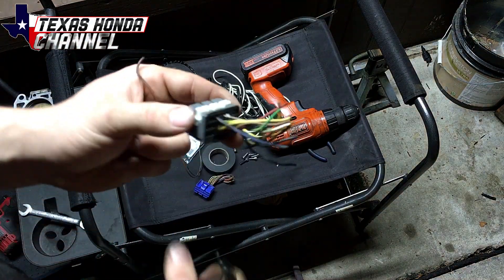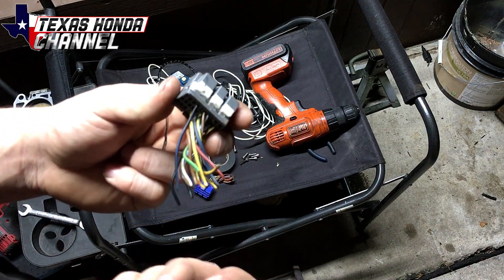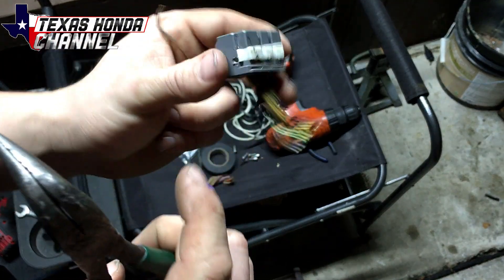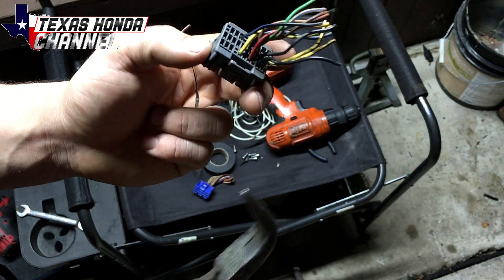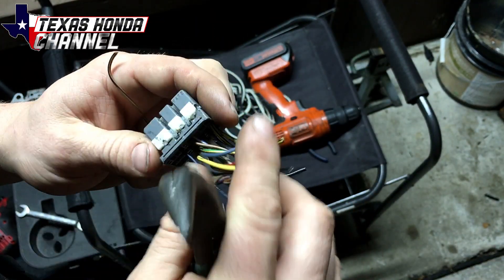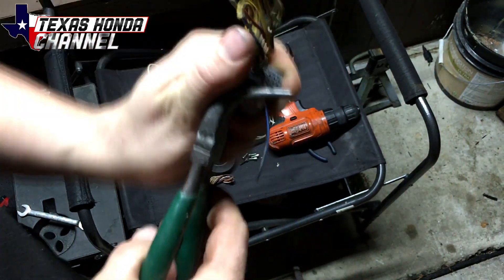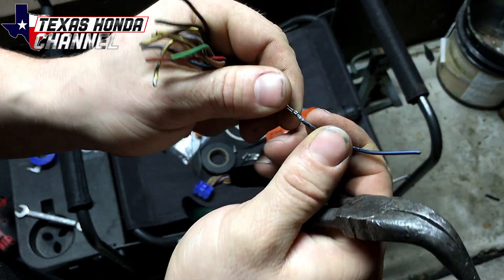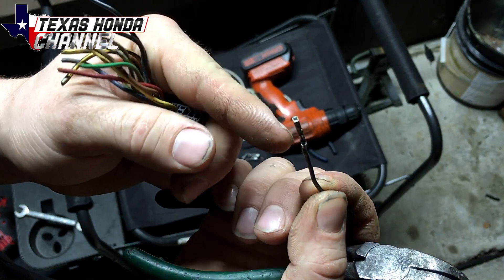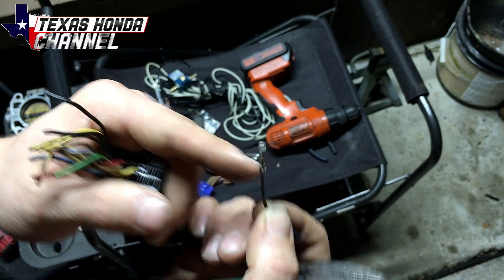One of the ways is to get an old connector — you're going to need to de-pin it, because most of the A11 on the ECU side is missing. You'll want to pry this white piece up right here. There are proper ways of de-pinning; this isn't the proper way, but I'm going to show you a way that does indeed work. I just grab it with the pliers like this and pull it out. You can damage it doing this, but nine times out of ten I don't. That's just one way of doing it, and then you'll take this and pin it into the ECU side.